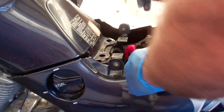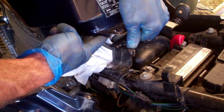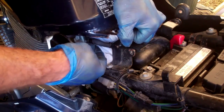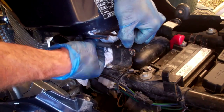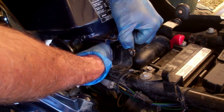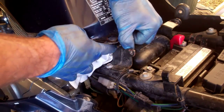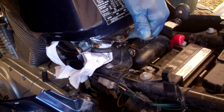So as we can see now these fairings are away from the tank and we're going to get access to this to remove it. Now that we have access to the bottom of the tank as I lift it — there's a clip right here. A little pair of needle nose pliers will be good for removing that. Put some cloths or something to safely catch the fuel — we turned off the fuel but there's going to be a little bit left in that line. Pull that fuel line off of there and safely dispose of those cloths afterwards.